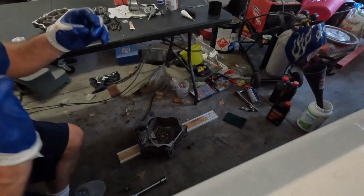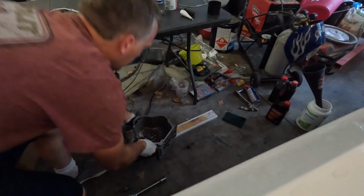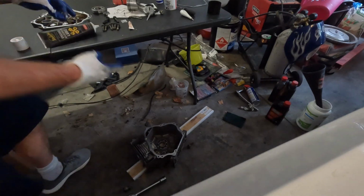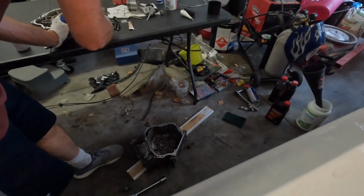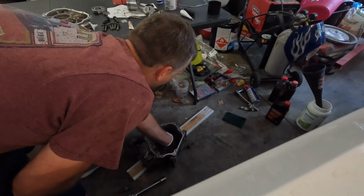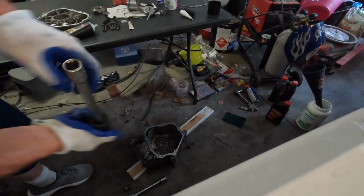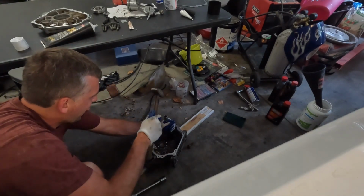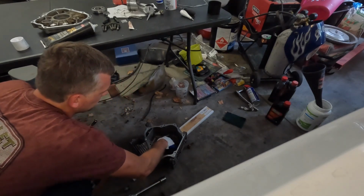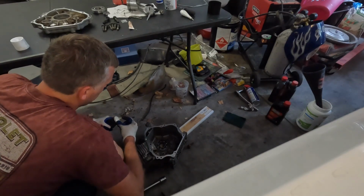So you can see the bearing is in and seated. So now we'll put the smaller bearing in, which is a lot easier. So again, we'll lube up the gallery where it goes, and we'll lube up the bearing. This one I have a socket turned backwards on itself to get it to tap in. That was a whole lot easier than the first one. Put some assembly lube inside here, on the surface of here, on the surface of the bearing too.